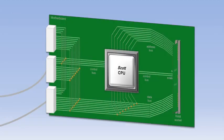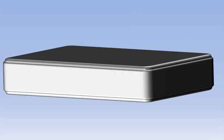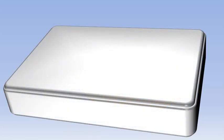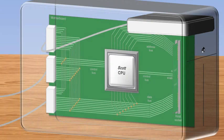So we'll zoom out to see how the motherboard fits inside the computer case. In the computer case is the last component we'll look at, which is the hard drive. As soon as the power to the computer is turned off, all the data in RAM is lost, so you have to have a way to store it more permanently — for that, we use a hard drive. Inside the hard drive is a spinning disk covered in tiny magnets with a small metal arm floating above it. The arm moves around to different parts of the disk where different data can be stored and retrieved. The disk and the arm generally move very quickly, but nowhere near as fast as the CPU can process data. For this reason, all the data from the hard drive must first be moved to RAM before it can be processed.